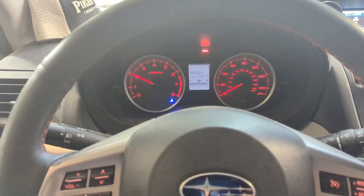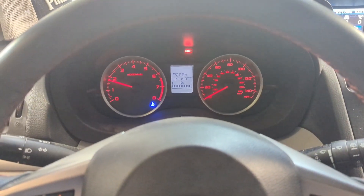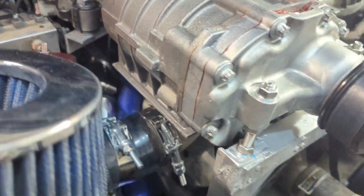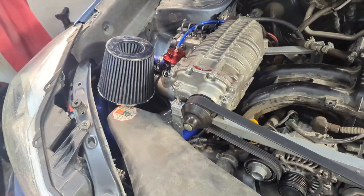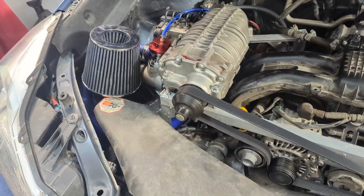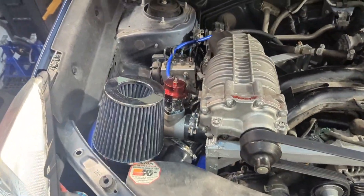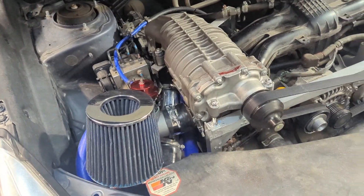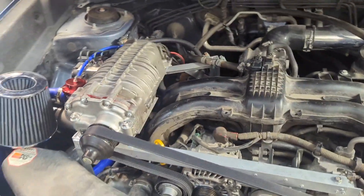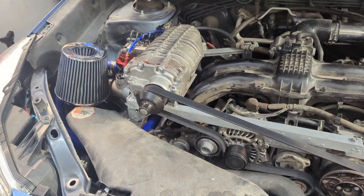It is more muted - interesting. Let's go for a test drive and see if the boost holds up. Just got back from the test drive with the baffle and the JB Welded output flange. Both did a good job - the baffle cut down on the noise by about a third to a half, subjectively. It's definitely still the main noise you hear when revving, but it's not overpowering. On the highway, especially in fifth or sixth gear, it's totally fine. The boost pressure is the only disappointment - I was still seeing no more than two and a half psi once the car warmed up.